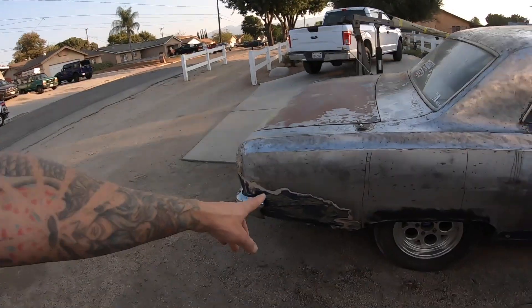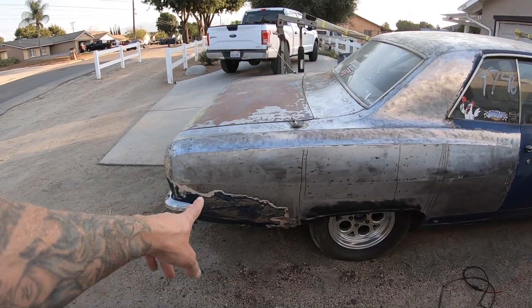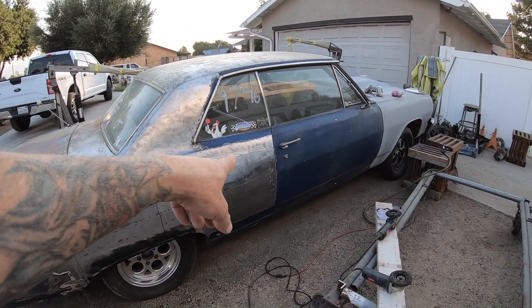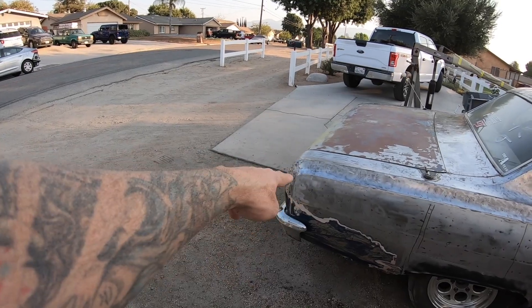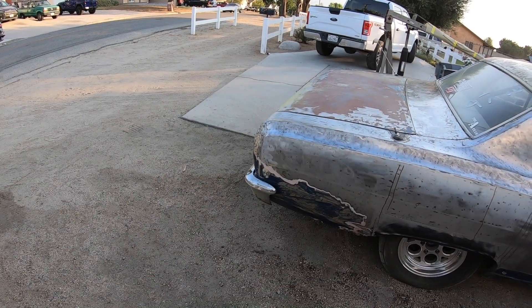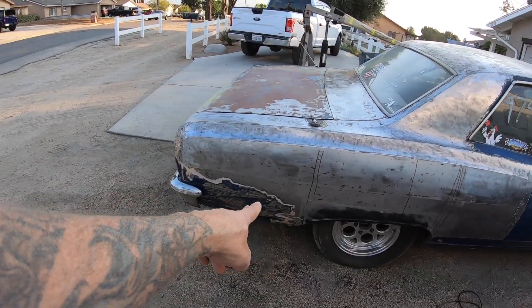I'm already two patch panels deep, and had I known it was that bad I should have stripped it before buying patches. I could have bought a whole quarter. But we're not really trying to go that route, so I will do some stud work on it, pull it a bit better so the filler's not so thick, and then we're just going to fill that back in. When the lower quarter patch panels come I'll show you how to cut those in, and I can show how to make one from scratch. We'll stud work it, maybe time-lapse it, and mud it back in.